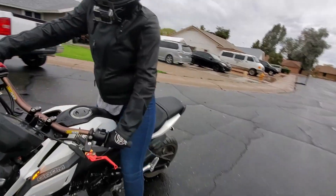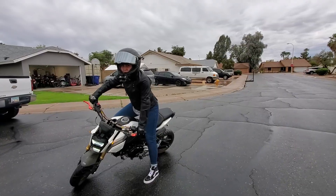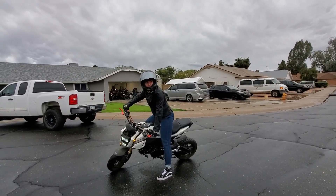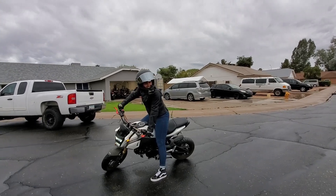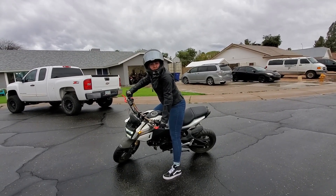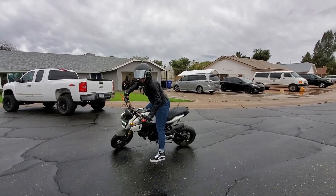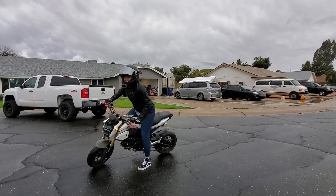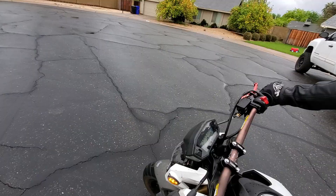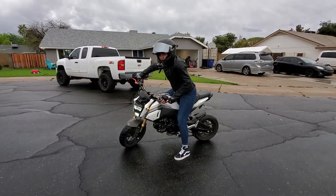Same thing — the only thing that's gonna feel awkward the first time is kind of the pivot on your foot as the bike swings around you. Turn your head the way you're gonna be turning, look towards the ground over there. Give it gas and it's just gonna start to come around on its own, then pull the clutch in to stop. Keep your fingers on the clutch without letting it off entirely. The key is lean that bike over a lot.